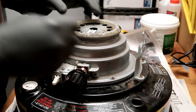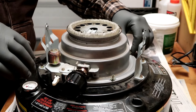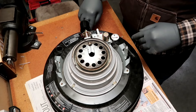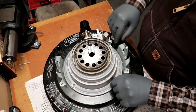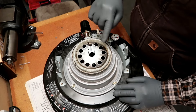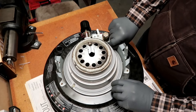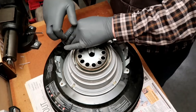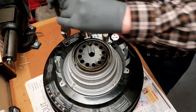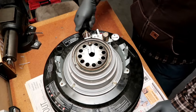Then you want to test all the mechanisms — especially your safety shut-off with that brass weight. Very important to test that for obvious reasons — you don't want a gigantic Molotov cocktail in your garage while you're working on your car. Reapply all the wing nuts and test the igniter. You can see it heating up, going in and out, up and down — everything looks like it's working as it should. As one extra precaution, use the pliers to make sure each wing nut is nice and tight.